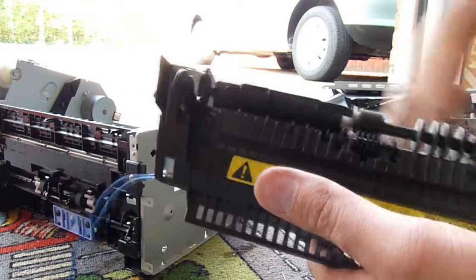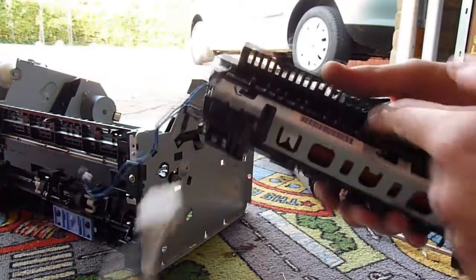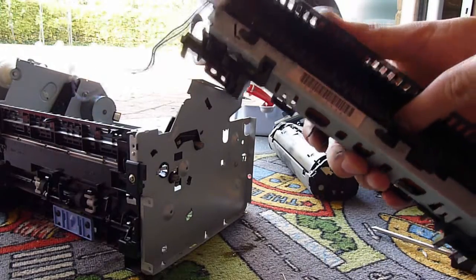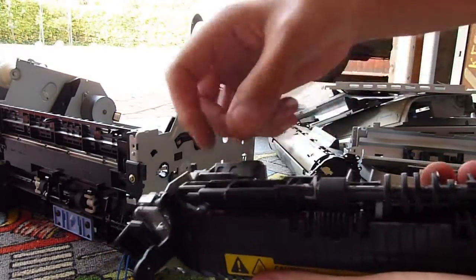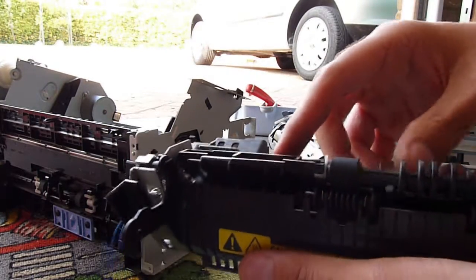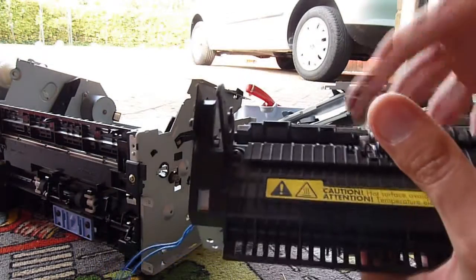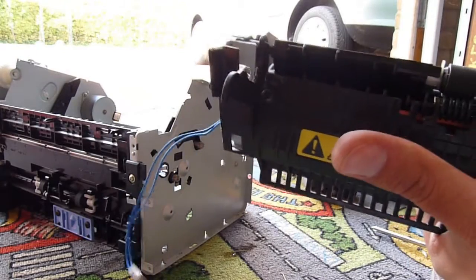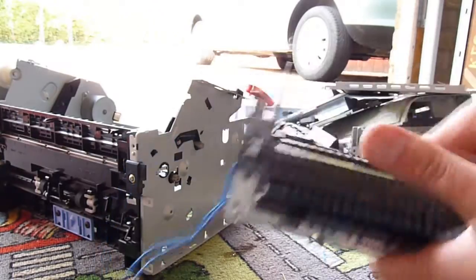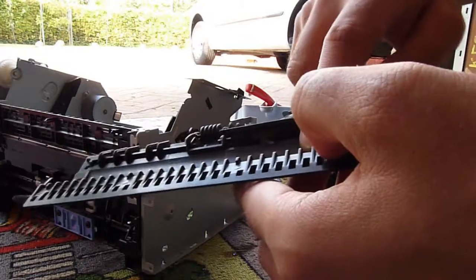Look at this big pile of useless crap — including the toner cartridge. The paper goes up here. I'm not sure if it goes round this bit or behind this bit, but it eventually emerges out here to where the optocouplers are — now gone, but they tell the printer it made it through. It's why laser printers have that unique smell and also heat. Another thing to note: this is very brittle plastic here. It's not ABS — it's actually PET.